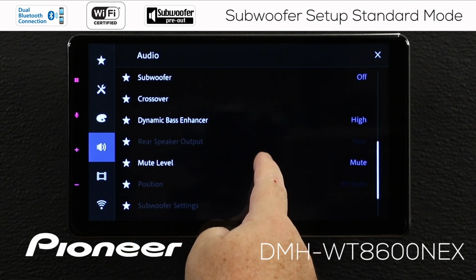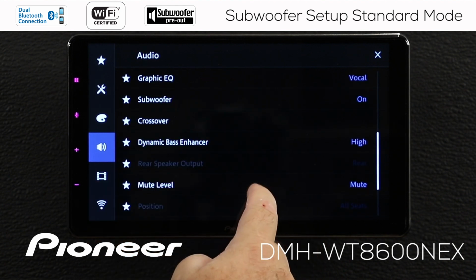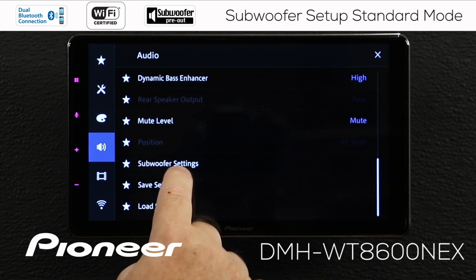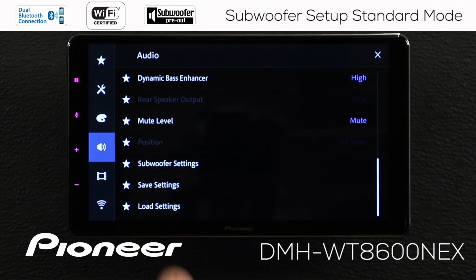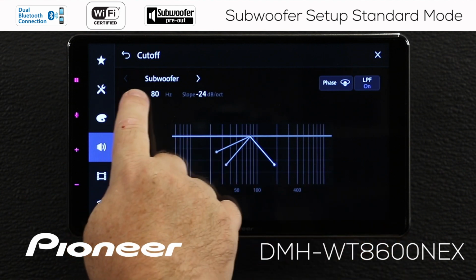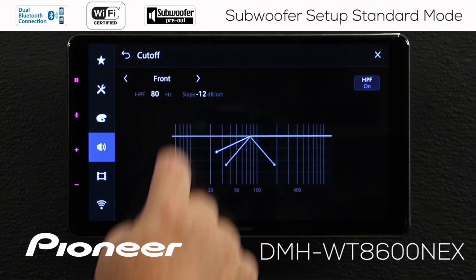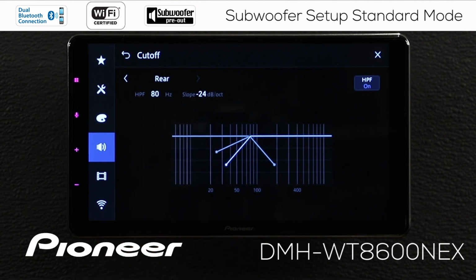So let's go back up here to the subwoofer. Let's switch subwoofer on and scroll down a little further here, and you can see now that the subwoofer settings become available to us, and we'll select that. So there's a lot of information on this subwoofer screen here, and here you can see we have the crossover for the subwoofer. If we hit this arrow over, we can move to the crossover for the front outputs and for the rear outputs, and back to the front and back to the subwoofer output. That's the one we're interested in for this video.